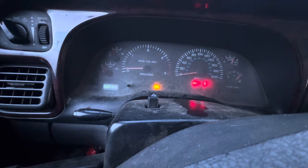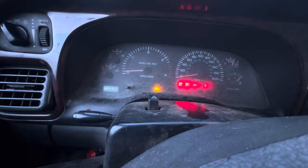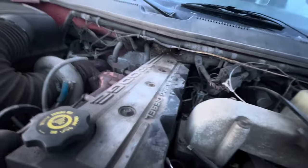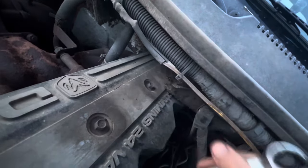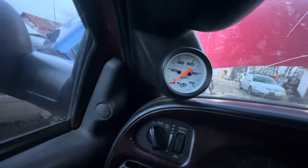Come on. I got injector lines cracked. Oh well. We'll let this charge for a minute, but this'll help. Alright, well, you got all the battery. Your injectors are wet. So the pump is working and that's good. And I know I should let it fire up and all that, but it shouldn't need that. You don't need that. As soon as the grid heater comes on, we'll just trip the grid heater.